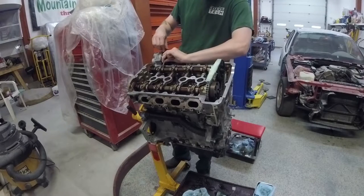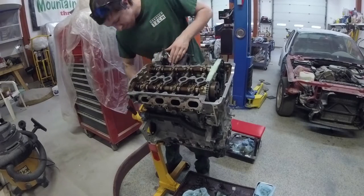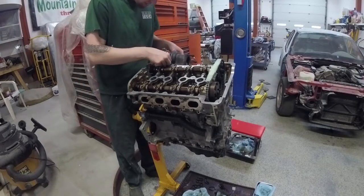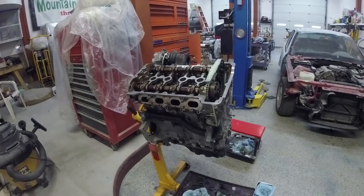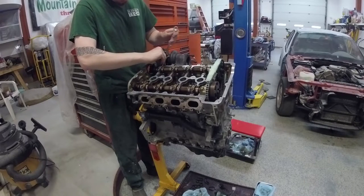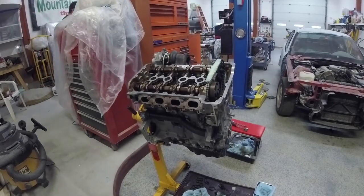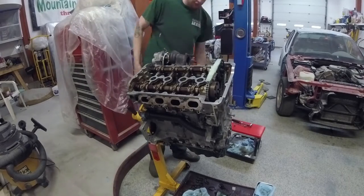The line is going to go — you want it to kind of go straight up as much as possible. That is a little tricky to accomplish when you torque it down, but you can make it happen. You want to make sure all these connections are tight. They do not need Teflon tape; they do not need thread sealer — they are self-sealing threads. Crank them down hard, don't go nuts, but crank them down hard and you won't have any issues. And there's the banjo tight.